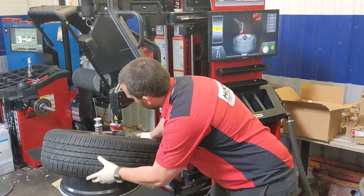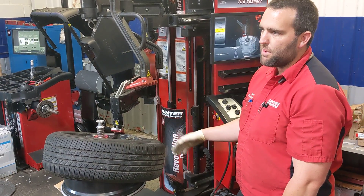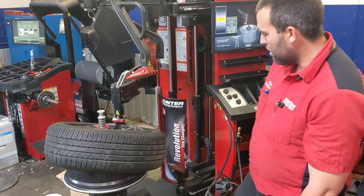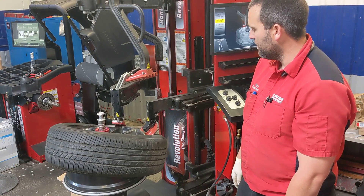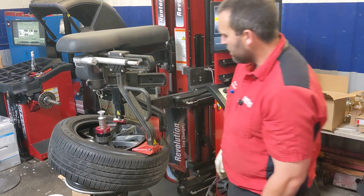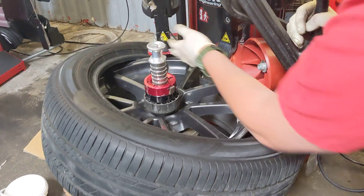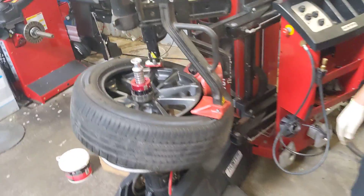Make sure you have your tire set up properly, just like you would on a normal tire changer. It's going to stop again — make sure the D-mount head is in the right position, let go of the pedal, then press it again and hold it. Make sure the upper bead is not over the hook — you want it underneath the hook, or else as it rotates around it'll totally tear that bead.